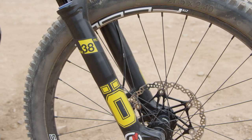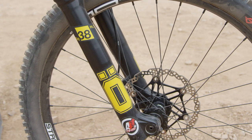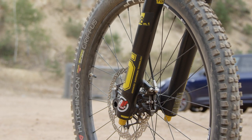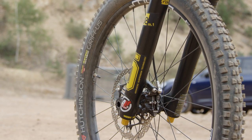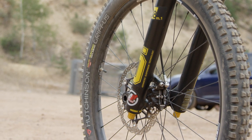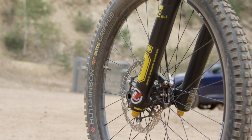Just to put things into perspective: a rider of 70 kilograms, if you're looking for 20% sag — which is actually not much sag, as a lot of riders on that fork want 30% sag — you'd put 210 pounds in the bottom chamber. He's running 250, and you'd put 95 in the top, but he's got 210 in there. Can you imagine how hard that fork feels? Insane — and he's using all that travel all the time.